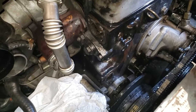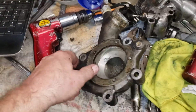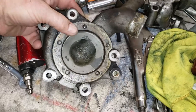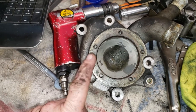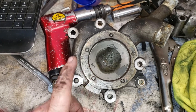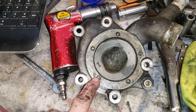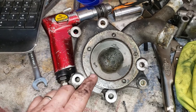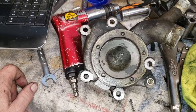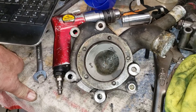This looks kind of bad but it looks way better than it did. One of the things I found with the water pump — I decided to go ahead and replace it — and lo and behold, we broke off another bolt. The previous owner had green coolant in this car, and I'm assuming we've got a lot of bi-metal corrosion. The water pump is steel, the bolt is steel, and the housing is aluminum, and all that galvanic action set up. That bolt is not coming out. I'll have to take this to a machine shop — I don't have the proper tools here in my shop to get that out.